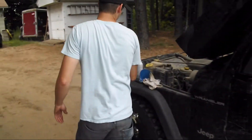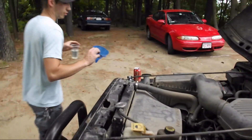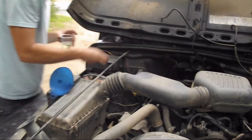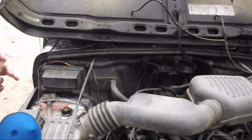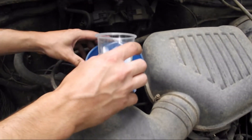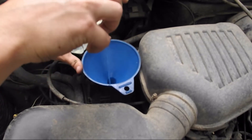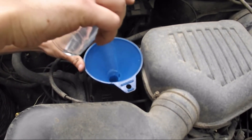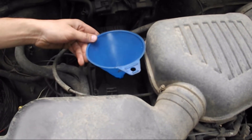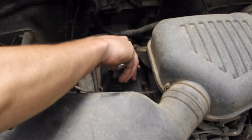You're gonna take another third and put it into the oil of the vehicle. You want to do this about 500 miles before you change your oil, because this is gonna loosen everything up — get all the gunk and sticky stuff off the inside of it.